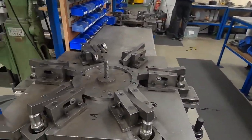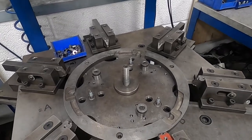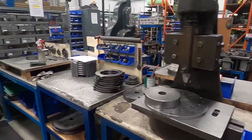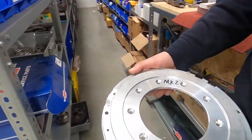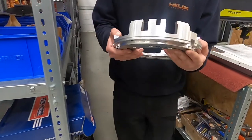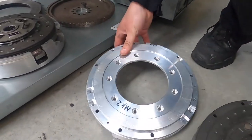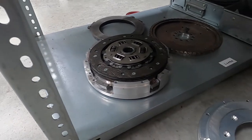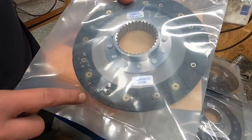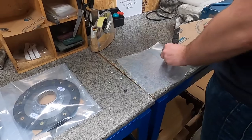There's a little assembly area with test rigs where covers get tested - it tells you how much the clutch is lifting, how much travel there is, and a clamp loader to measure how much torque the clutch can take. Everything is assembled by hand. Here's a Lamborghini cover shell made out of alloy - the Lamborghini uses the same engine as the Audi R8, so it takes the same clutch. Helix makes their own spring, drive plates, everything in-house. The only thing they buy in is the facing material, because the UK supplier is the only one that makes it.